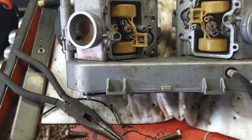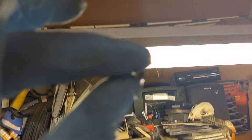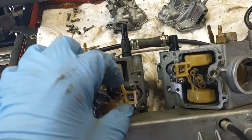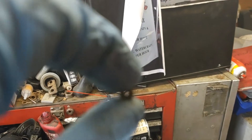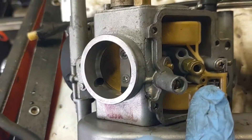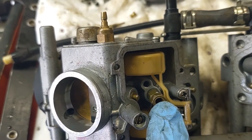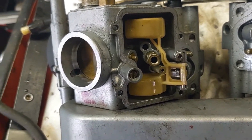This is the pilot jet - it's got the smallest hole of any of these jets. I can't quite see through it so there might be something in there. Just take a piece of wire, strip the insulation off, and stick one strand through there to clean it out. This is the main jet - normally it has a big hole so it very seldom clogs up unless you've got something really big in there. There are also two emulsion tubes on this thing - you want to unscrew both of those to make sure they're getting clean because I've seen them get gummed up as well.